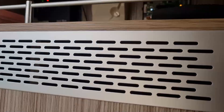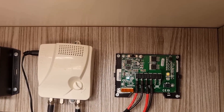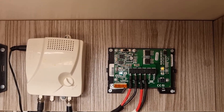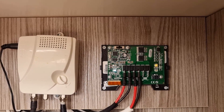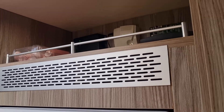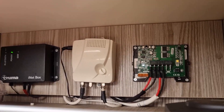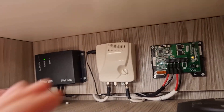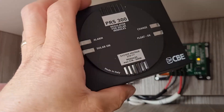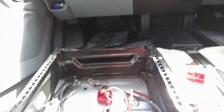One quick thing to note whilst working on the electrics — I didn't put this in the first video, I don't know why — but disconnect the solar panels from the battery so there's no voltage going in and no way it's going to trip out. That lid just literally pops off.